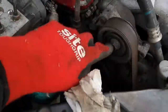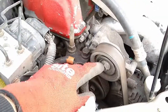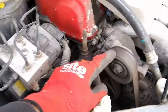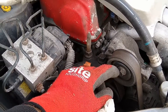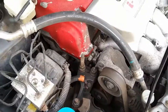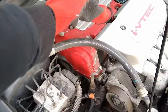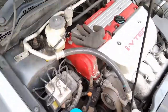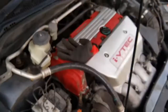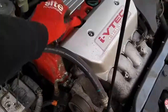My plan was to try and get a replacement bearing. The Honda tensioner is about £30, but the bearing I've bought is £6. We should be able to press the bearing out, put a new one in, and that should fix it. I think it's a 6203 bearing — a 6203 2RS — that's the replacement bearing, at least according to the internet. Let's start it and see what it sounds like.